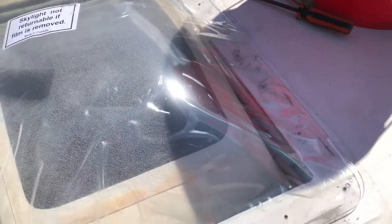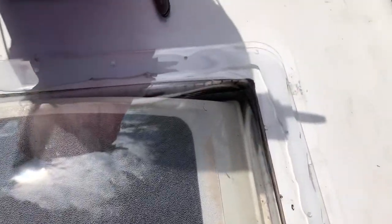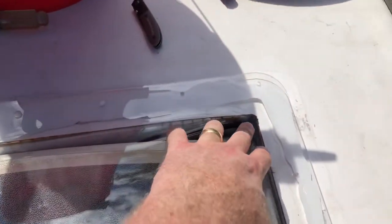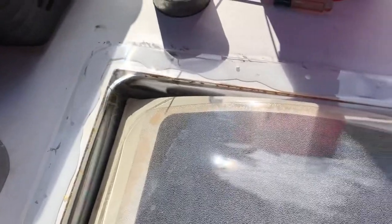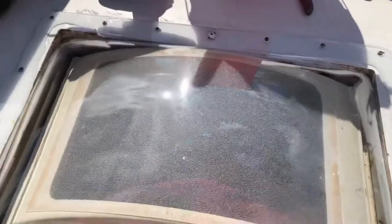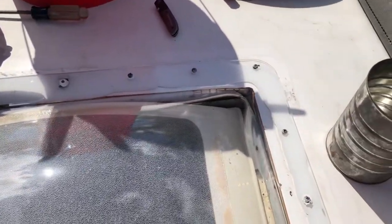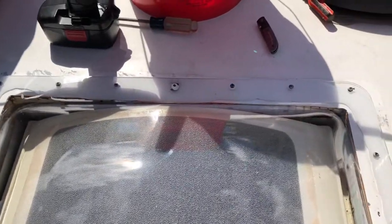The other thing is you want to put down a layer of lap sealant under the skylight to replicate the factory seal that was on there to start. You can see where I put my bead down and then put the skylight over it — squished it down nicely. I don't have a very steady hand so it's not a pretty bead, but looks like we have no areas where it's not sealing. You can see how it does push up a little bit — and again that's what I'm talking about, not tightening too tight because you don't want to break it or put torque on the skylight. Next step is the screws. Lap seal spread out nicely — I'm going to go back and hand tighten some of these.